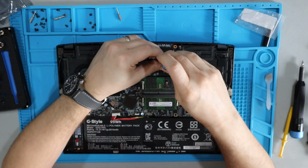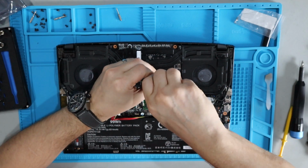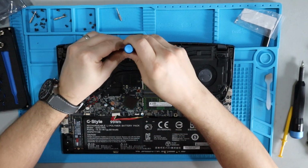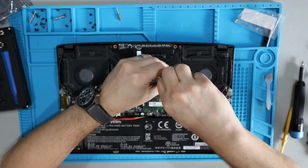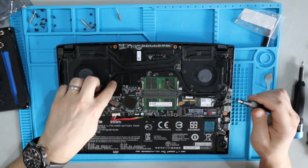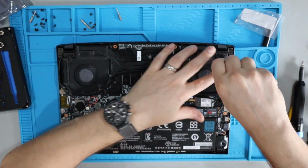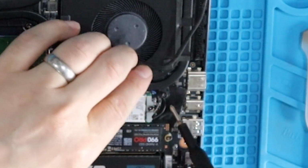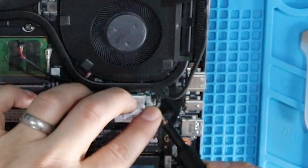And then I'm gonna go through and torque it down a little bit. You gotta be careful with this stuff. You don't want to break or strip anything out. I don't know how to describe to you the right amount of torque other than I've been doing things like this for years and I've just got a feel for it. And I know where I want to go without breaking anything, and at the same time making sure there's enough pressure on it to hold it in place so it can do the job that it needs to do. I feel good about these CPU and GPU mounting points, so I'm going to go ahead and get the fan chassis screwed in here along the outside. Watch out, there's a wire here that is going to get pinched if I don't move it out of the way. There we go.